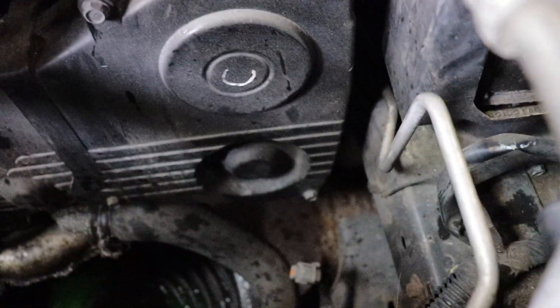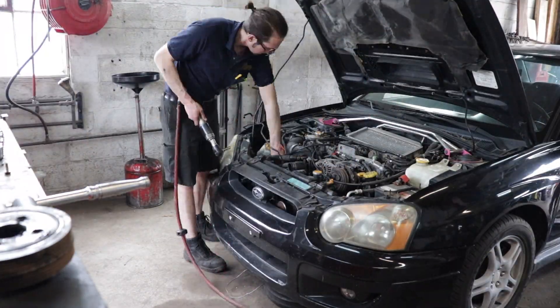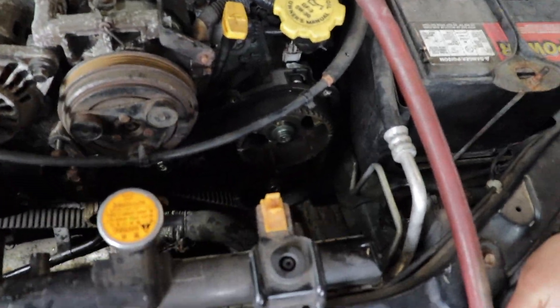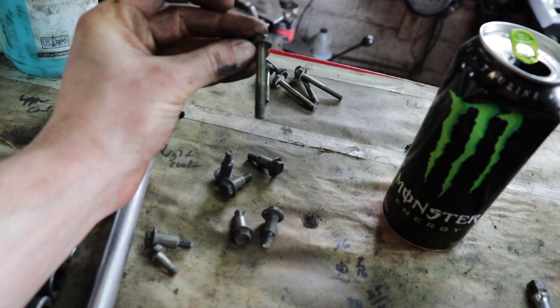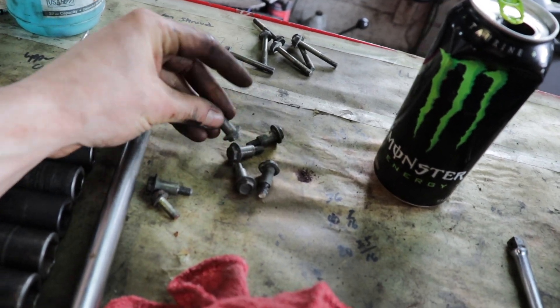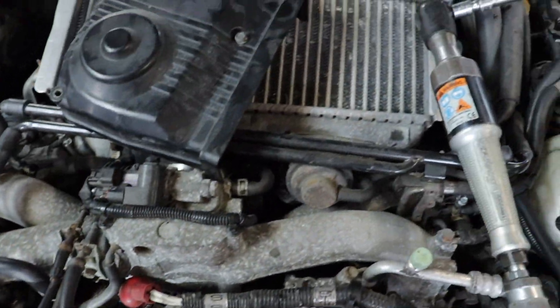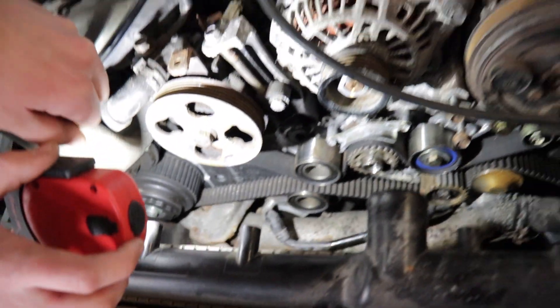Now it's time to get the front cover off — just all these little 10-millimeter bolts all the way around. One thing I forgot to mention: the outer covers for both the cam brackets have to come off first and they take these long bolts — pay attention to that going back together. Then the center cover comes off last and it has shoulder bolts, so they are different. There's also one hiding in the center on the left cover — right there — and it actually broke the insert out, but you've got to get that one too to pull that cover off.